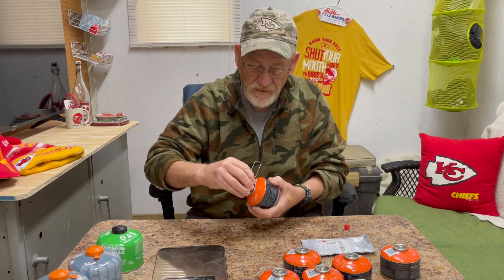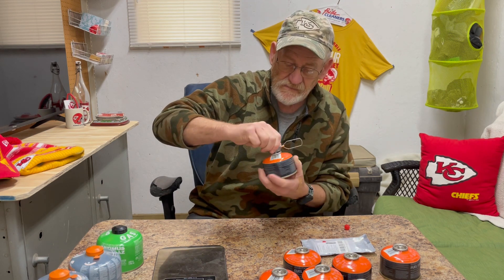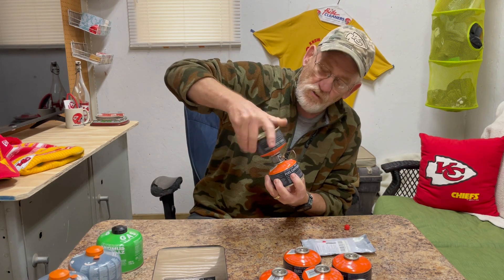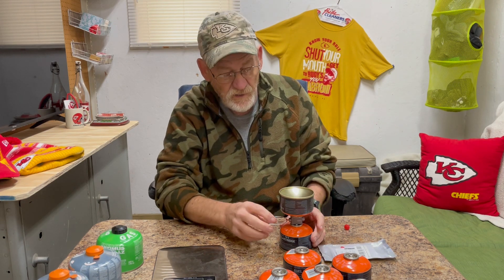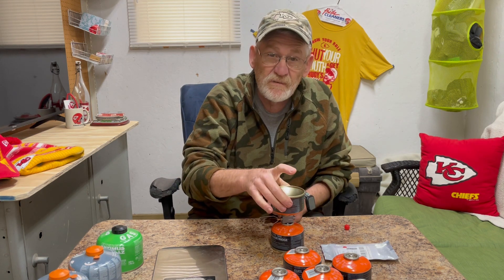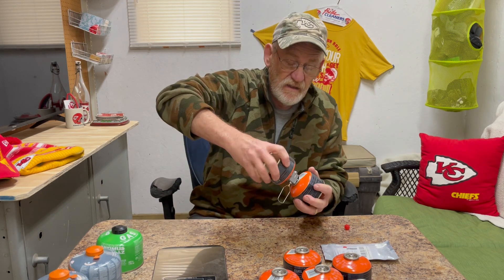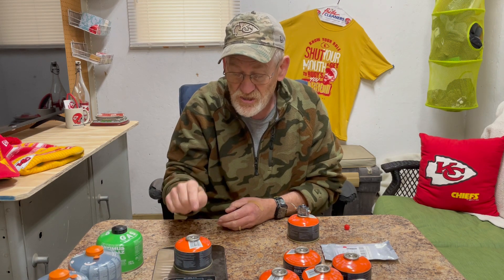It's got an arrow — it says 'down to in.' You put the other one on the top, and you want it upside down so that the liquid goes in. Then all you have to do is open it up. Because this is cooler, the pressure in this will be less than the pressure in the warm one, and that greater pressure will force the fluid down into this. You want to do it in small increments — put some in, shut it off — and make sure you don't overfill it.